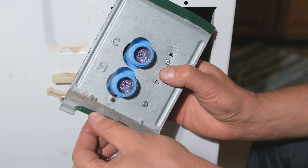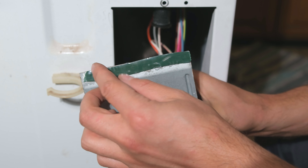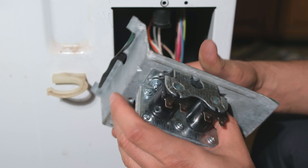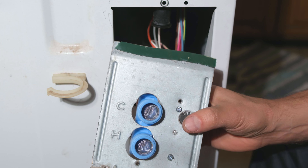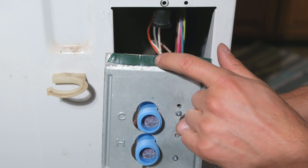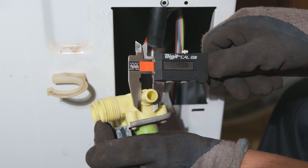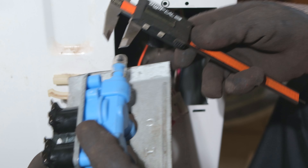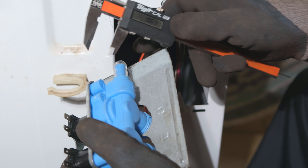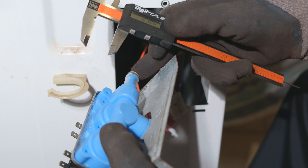This frame is going to rest on the spongy tape so it's not going to make noise. At the top I've put tape but I'm not opening both sides there - I don't want to stick it permanently because it'll be very hard for the next person to work on. All I'm trying to do is make sure it's damped. The screw hole is covered but that's not a problem - when I put the screw in it'll just break through the tape. Looking at the old spout, the thickness is 12.5mm. On the generic replacement it is 10.2mm, which is too thin, but with the plastic piece included it measures about 13mm.